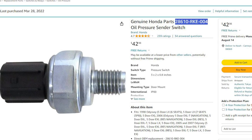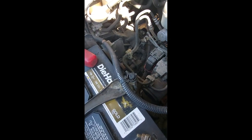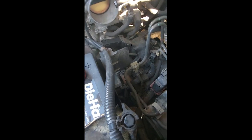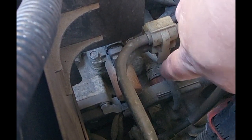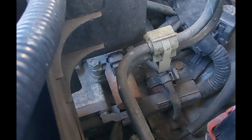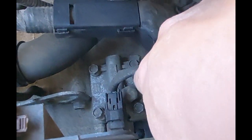I'm going to show you where they're located. On the right side of the engine, from the top, looking down behind the battery, you have the air filter and the air intake hose. You remove all that, and then you'll see, just underneath the air intake hose, the pressure switch. There's a wire harness just above it — I'm pointing to it right here. Just underneath that is where this switch is located, connected by a wire. You undo that, then remove a bracket holding some hoses and electrical components — four bolts — and then you can get your wrench down on the pressure switch.